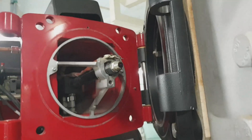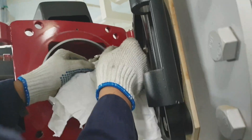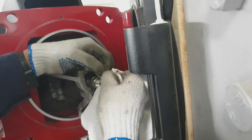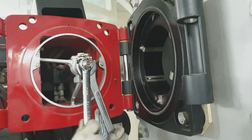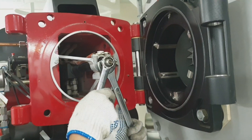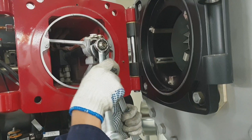I am using only a clean cloth to clean the electrode — I am not using any abrasive paper, just to protect the texture. Once the texture of the electrode has been damaged or becomes rough, it will attract carbon that may lead to the electrode working inefficiently.